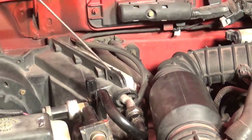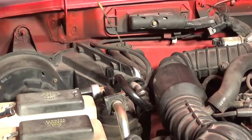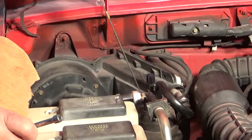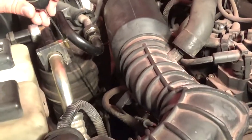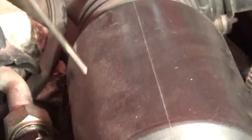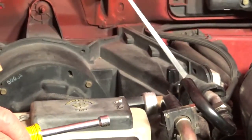Here's what we have: a line coming in here and a line coming in here to this accumulator. A couple of things have to be taken apart. This line has to be separated, this line has to be separated, and this pressure switch has to be taken off by disconnecting the electrical. The actual switch can stay there until I get it off — then I'll put it on my new accumulator. If you can see where I'm pointing, there's a little 5/16-inch wrench nut down there on the end of a screw — it's a bracket that holds this round cylinder, the accumulator, in place.